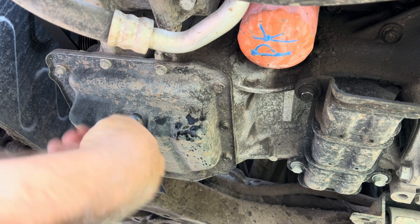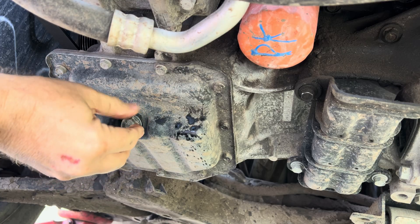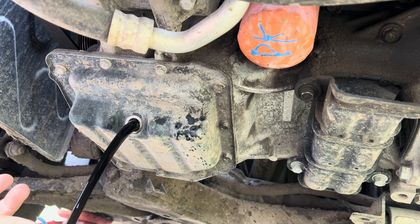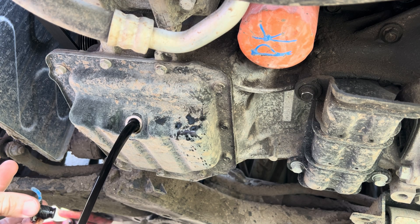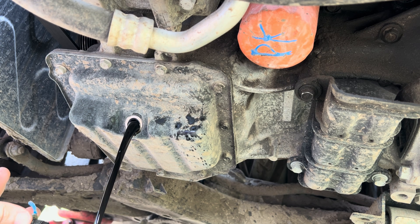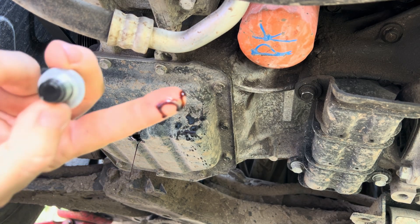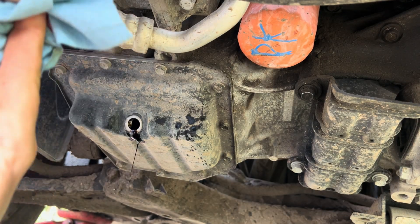That's not bad. I do have my oil pan under here — this is draining. I want to mention that a lot of shops will offer oil reclaiming service for free. What I usually do is drain this pan into an old oil jug and carry that to the shop — once I get a handful of those together — to have a good disposal place. I let this drain for a few minutes until it gets to just a fast drip. The oil is dark but it's not black, so it's definitely not gone past its prime.